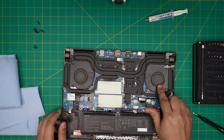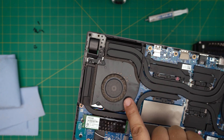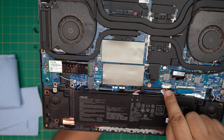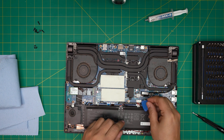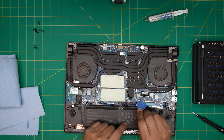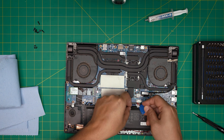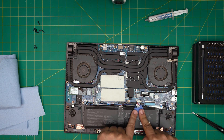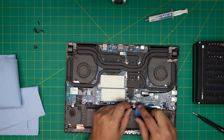Look at the fan — how dirty and clogged up it is. We want to clean it up nicely and replace the thermal paste, but first we're going to remove the battery. To remove the battery, grab a plastic guitar pick and push the metal lock back toward the heat sink slightly to get clearance. Then grab the cable, take the guitar pick underneath, and push it down — the lock should pop upward. It has to come upward; don't slide it back.